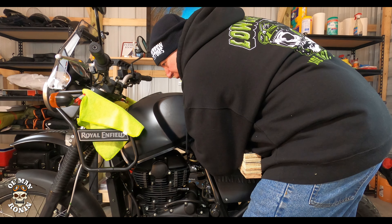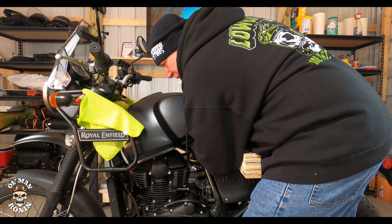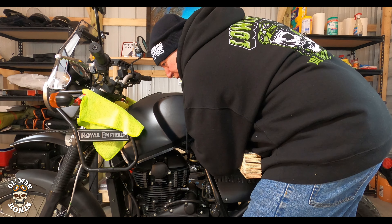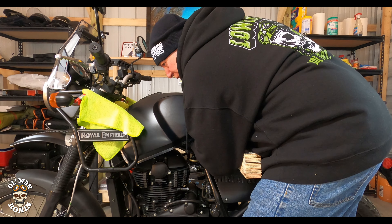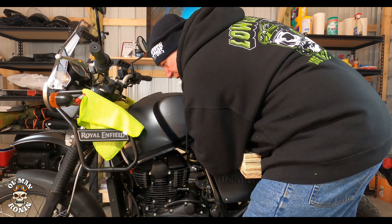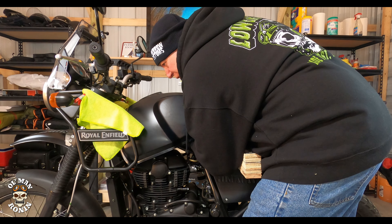Now on the right side of the bike, I'm going to show you two things: your fuel pump and your fuel line. The wire connector to the fuel pump — you have to squeeze the inside button and then it'll pull off. On the fuel line there's another button you need to pull. There will be some gas drippage, so have a towel ready to wipe that up. You can see the gas drippage — it won't be a lot, just cover it up. Push that connector in and pull it out as well.